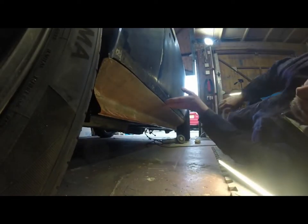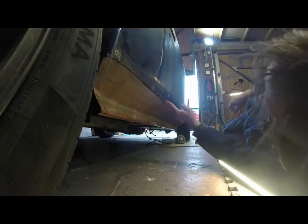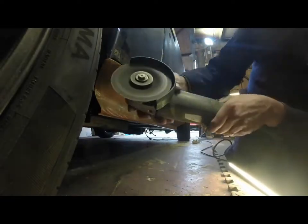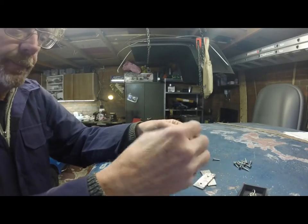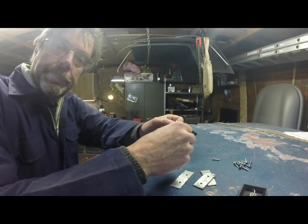Right, so we now have a line. Could possibly do a little bit more trim there, which I can join up with some alloy strips, I think. I'll just trim that little tiny bit off here. Yep, and I already have my alloy strips pre-drilled. So I can screw those in to force the thing to line up, and then I can set about aligning the two pieces of the fiberglass, and then laminating them. Let's see how that goes.